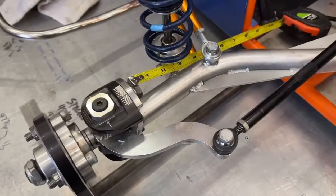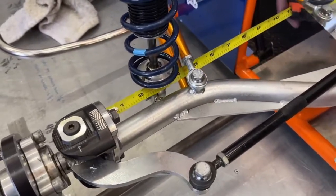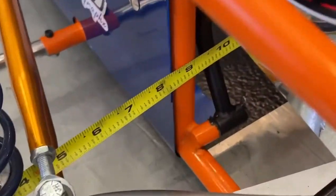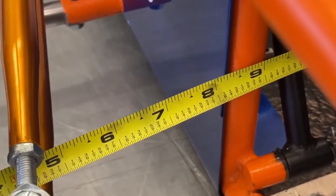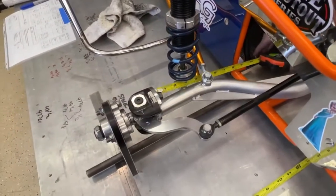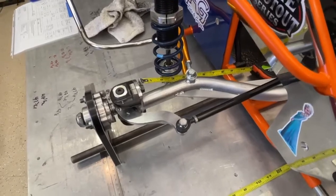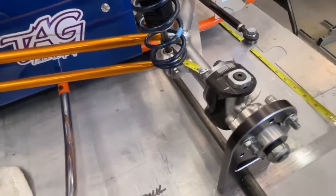Nervo calls out, I think, eight and a half for the front distance from the panel. Let's see - we're at about eight and three-eighths. We may go to eight and a quarter; Austin seems to like it at about eight and a quarter. So, we're also going to talk about the caster.